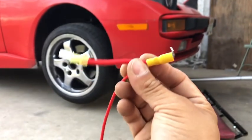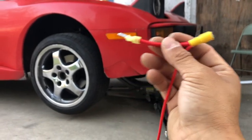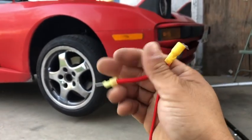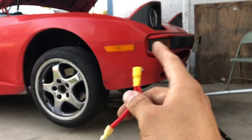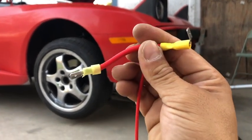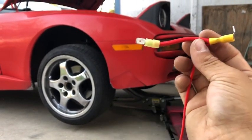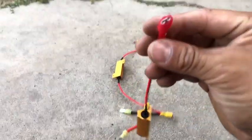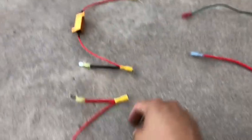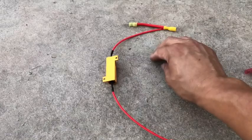For the DRLs, on this side you have the receptacle that goes in and plugs into the back circular receptacle to send the signal for the DRLs. This is basically the parking lights — when the lights turn on, that allows the side marker and these lights to turn on as well. I used a little piggyback Y connector, just about three inches. That goes into the harness, this goes there, and then I put a resistor with a female connector in there.